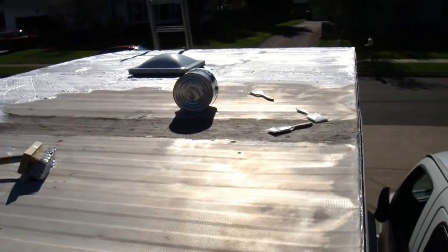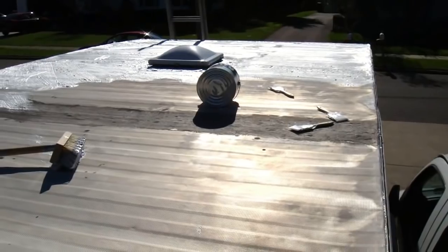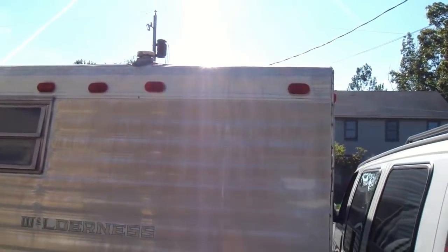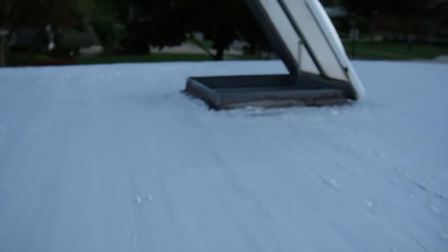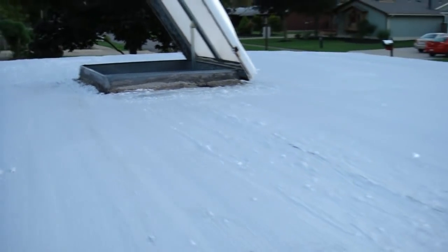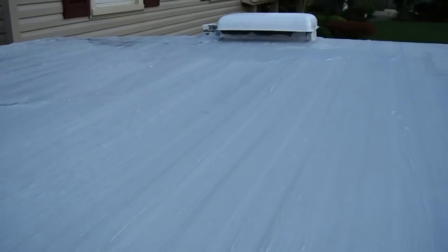It's a silver tar rubberized rubber-strand stuff — it stinks. It's hot and sunny, about 83 degrees, but there's no rain forecast for two days, and they say you need 24 to 48 hours to cure it. This is how I'm doing it: standing on top of my van and putting the stuff on top, with a ladder on the other side. Here's a shot of the roof after I got done. I put it on thick with all that sealer — it's still a little shiny and tacky. I think it'll hold; if I get five years out of it I'll be more than happy.